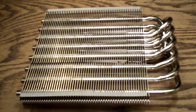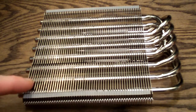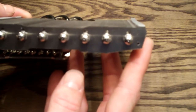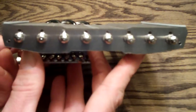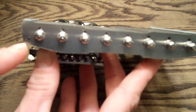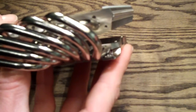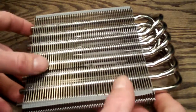To start this out, you're going to want to take your heatsink and then install the anti-vibration strips, just as I did here. You can see it's right along the raised edge of the heatsink there. And then you're going to notice that there are holes here — there's two on each side. Flip this around and you can see there are the same holes there. That is basically where you put your clips in.